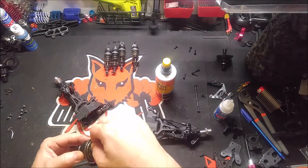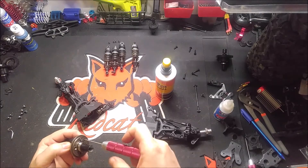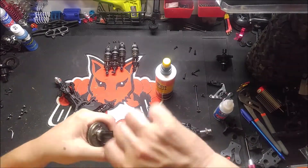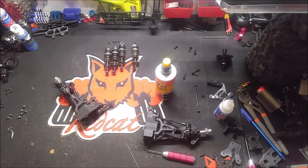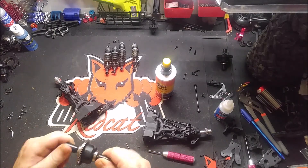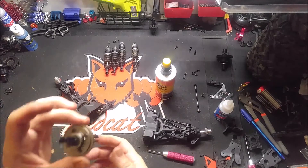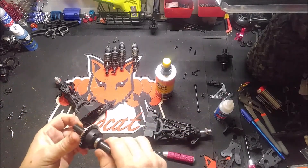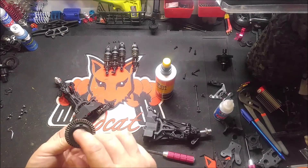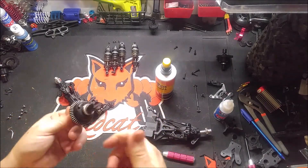I give it one more little turn just to make sure, and that's at a good fill height right there. It's right up against — not completely up against the top — just enough so that when I set this gear down in there and it smushes, it should leave me enough room to put that down. I know we'll get some seepage as I screw it down, but that's fine. It's got much more of a stiffer control now. It'll still give you that slip — this 60 is not much in comparison — but it's enough to do the job and make sure your gears are protected. Even if it's spinning and using the spider gears a lot, the friction isn't going to destroy the gears as quickly. This should elongate the life of the diff no matter what.